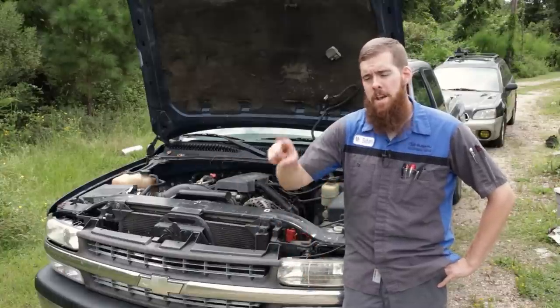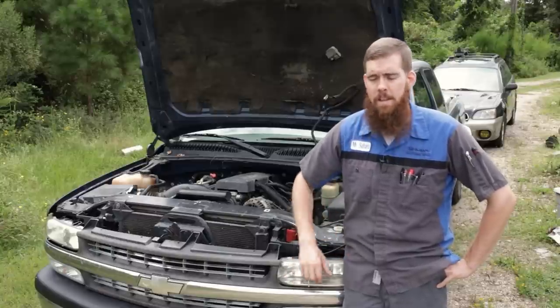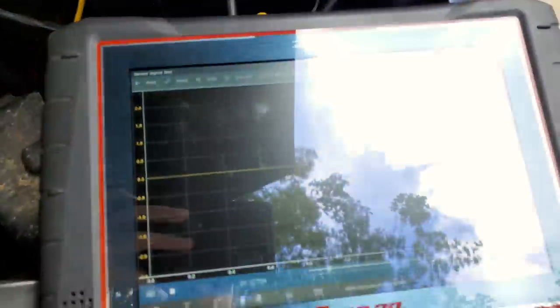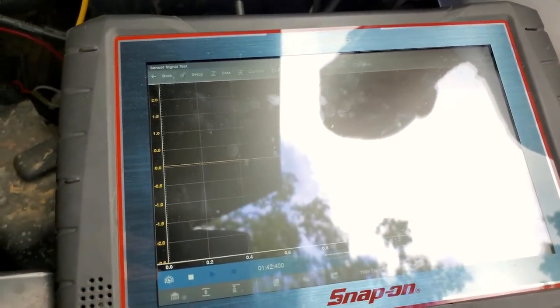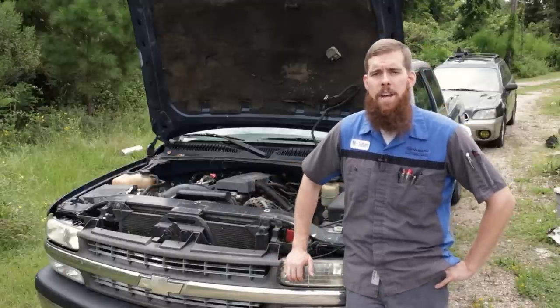or on the oscilloscope, you see basically a little EKG. You see the output jumping around. As you see in the clip, we've got good knock pickup signal on one sensor, and the other sensor is dead. Flatline, sensor's dead. I can't remember if it was one or two. Most likely it's number two. It seems always that the rear sensor rots out on these. So that's the way you check it really quickly.